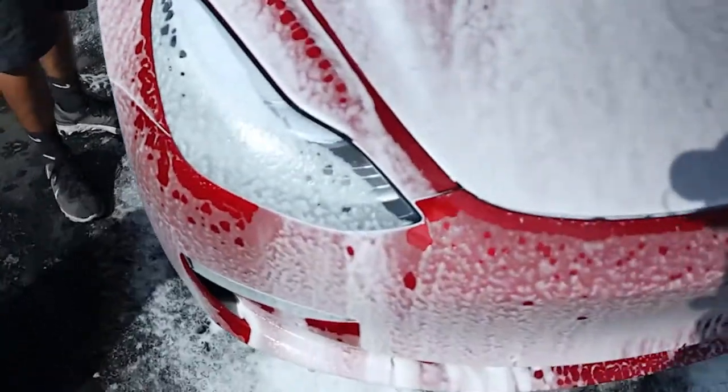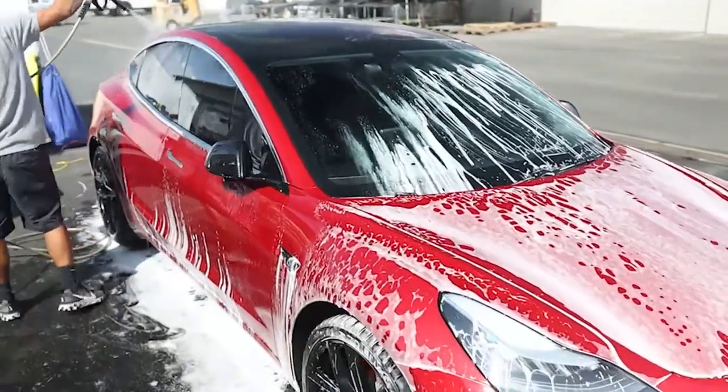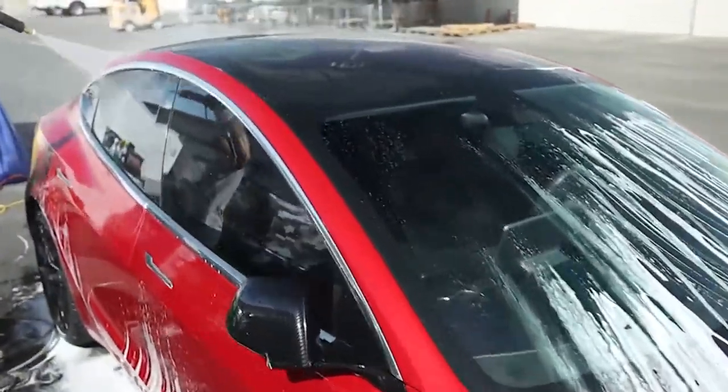Now that you know how important it is to have the car well cleaned before it is wrapped, you should know that a big part of what we do is actually prepping the car for you. So we have a service where we do the cleaning for you and then get the whole surface prepped. One part of it is the detail, the other part is doing a clay bar over the car again to get off any adhesive that's on the car, and again just to get the surface perfectly smooth so the vinyl adheres perfectly and also looks really good.